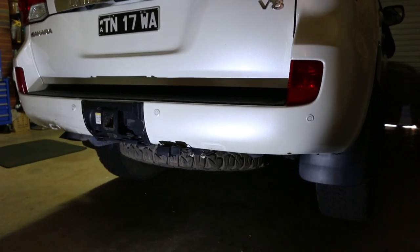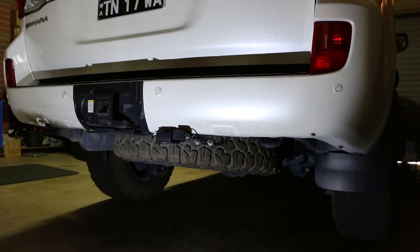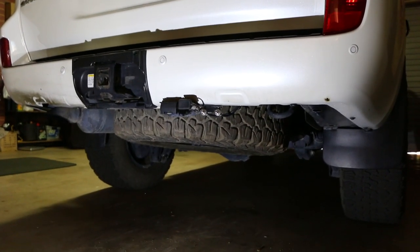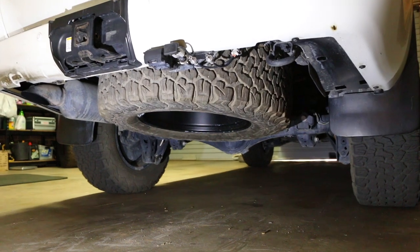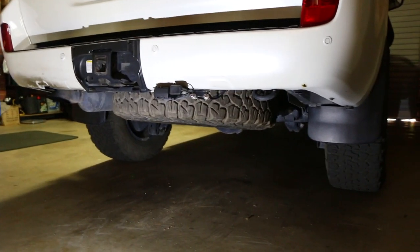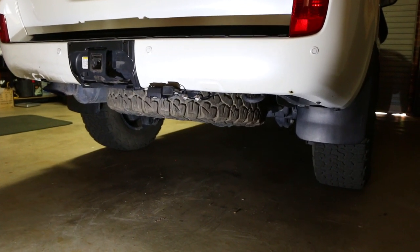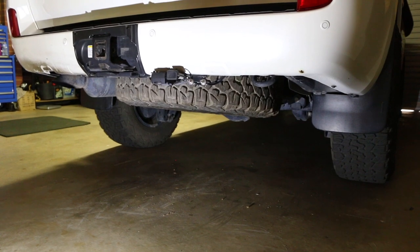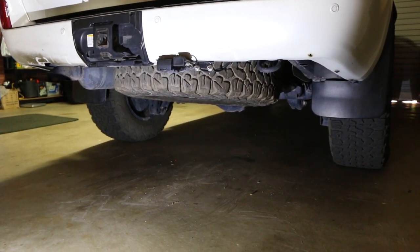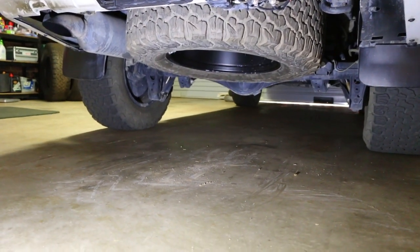Something I forgot to mention is the spare wheel. The Land Cruiser 200s have their factory spare wheel mount underneath the rear of the car. As you can see here, with these larger tires they hang down quite a lot, which really does impede on the departure angle of the car. It concerns me a little regarding damage to the sidewall while four-wheel driving before the spare has even been used. We're not running a rear bar, and it's something I'm considering but haven't decided on yet — so for the time being it stays there and it's just another factor to keep in mind. For those who want to fit tires of a similar size, these 305-65-18s do fit into the factory spare carrier without any modifications.